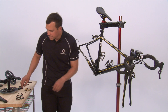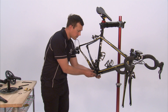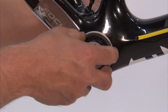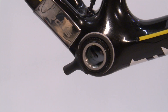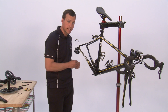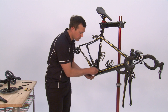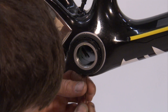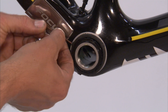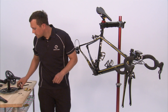Since this frame will accept the hangers, we're going to go ahead and use those as they're preferable. Install both of them on each side and have the magnet facing as far back as possible. Note that the grub screws do not need to line up with the grooves in the bottom bracket cup. Snug up all six of the grub bolts until the hanger no longer moves.